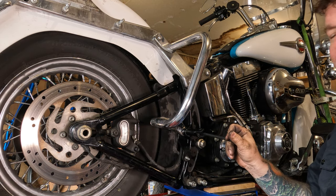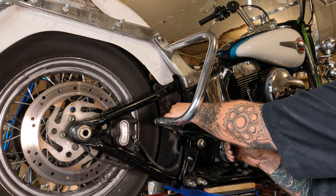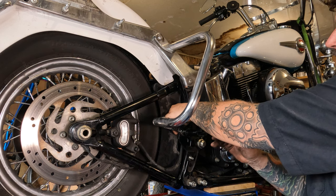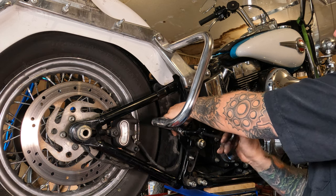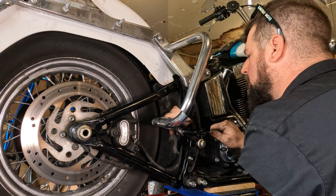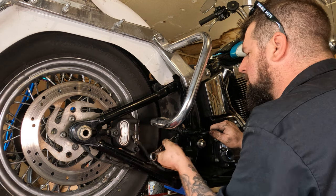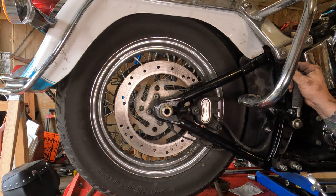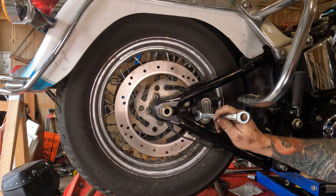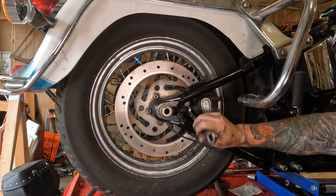They really love stacking stuff together here, don't they? Take your 3/8-16 nut, or you may refer to it as your 9/16 nut, because that's what size wrench it takes. Slide that thing back in there. Thread the bolt in so it starts on that nut. Realize this is going to be a tedious process. Okay, so you may remember when I took this thing apart, I backed the bolt out one full turn. So we're going to take it in 3/4 of a turn on both sides.